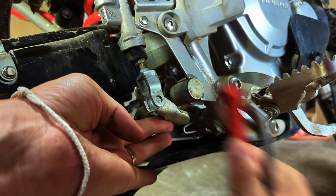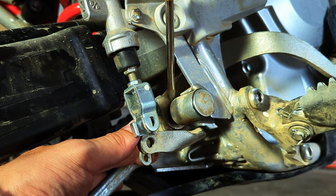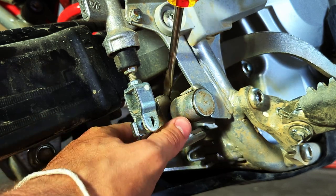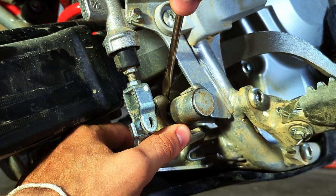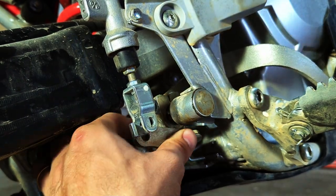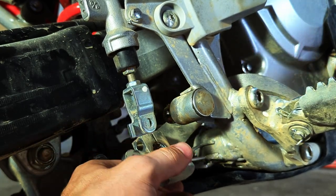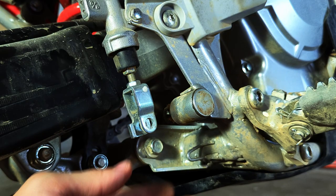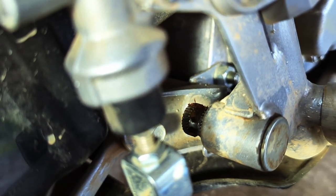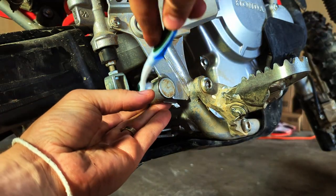From here everything is unattached, so I just took the soft part of my needle nose pliers and gave it a couple hits to knock it loose — there's some dust and dirt in there that makes it hard to just slide off. Taking a flat head screwdriver in the little slot and opening it up allowed me to get over that last set of teeth, and the pedal just slides out. I'm going to clean that out real quick; it'll make it easier to slide the new brake pedal in.